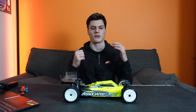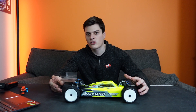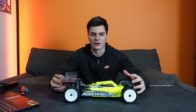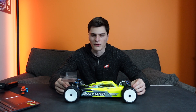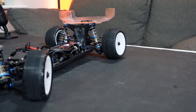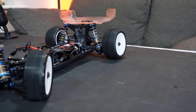Overall, thinking about roll bars on carpet — another thing to be aware of is that the traction is so high and you've got so much load transfer going on that often a limiting factor is actually more wheels coming off the ground and weird things happening, rather than just how the car is handling at the neutral point in a corner. So say you're going into a corner and you have the back wheel coming off the ground — how would you fix that?